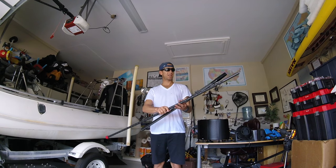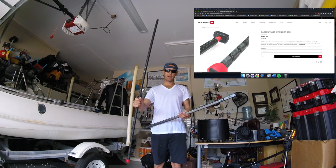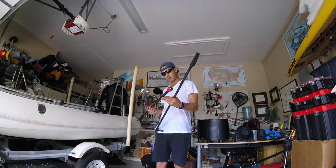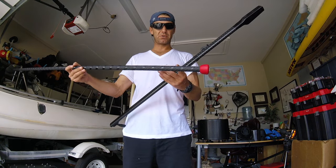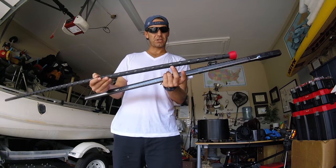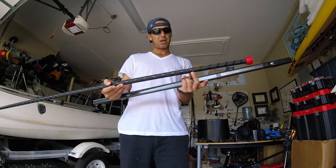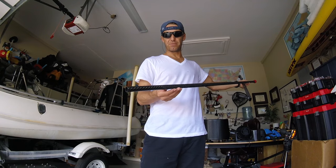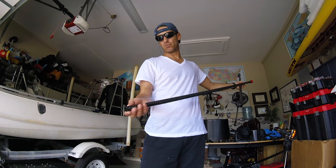Which is kind of nice because I can customize it exactly for me. Yesterday I went out, as you see in the video, and found where I needed to be. I counted seven stripes in — one, two, three, four, five, six, seven — and we're going to chop right about there. That's about nine and a half inches, but we're not going to cut this side, we're actually going to cut this side. I'm going to measure nine inches from here, cut it off, and then redrill the hole for the bushing.